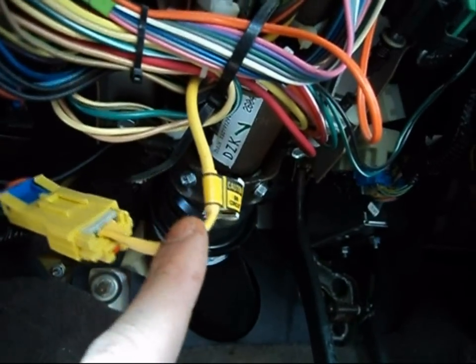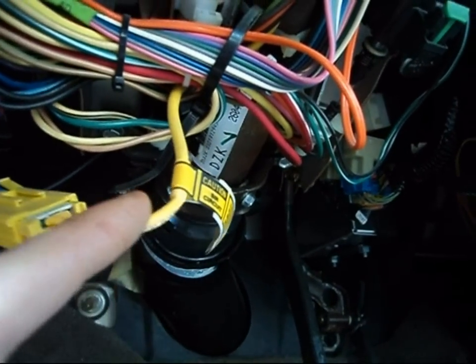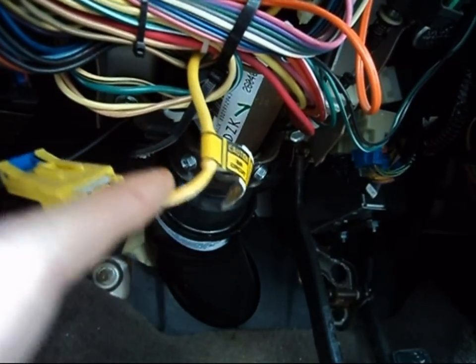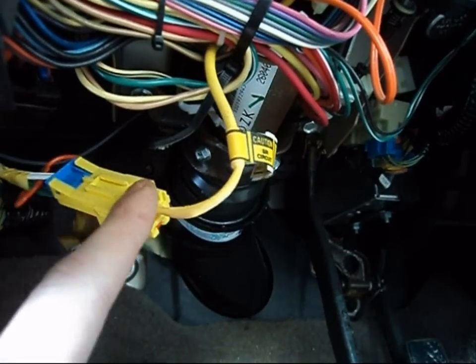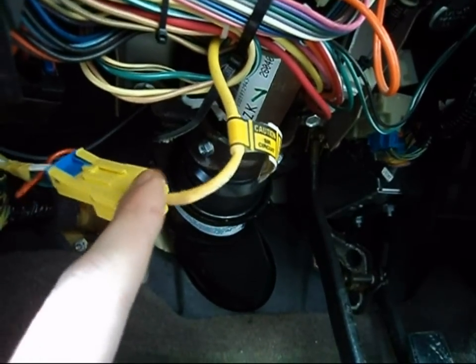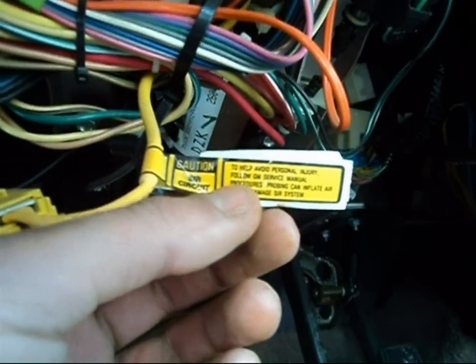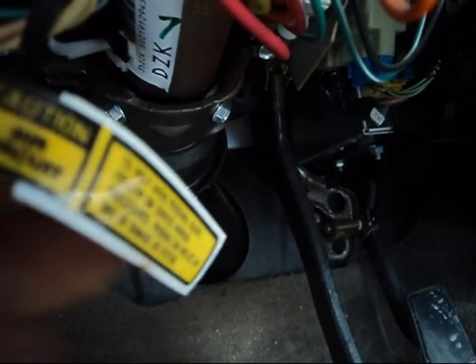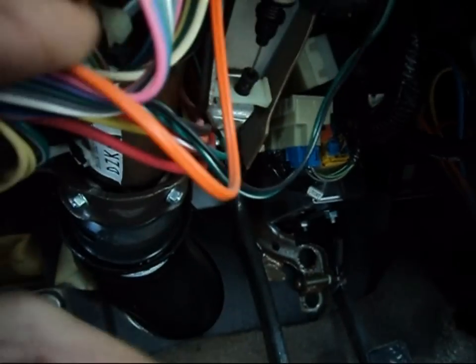Be careful. Don't manipulate this wire — this is for the airbag. Even though you pulled the fuse, be extremely careful when you're splicing wires in here that you don't accidentally cut the airbag wire. More than likely it won't deploy, but just try and stay away from this wire. It'll be labeled SIR circuit — Supplemental Inflatable Restraint circuit. Just stay away from it as much as possible and keep a good eye on what you're doing.